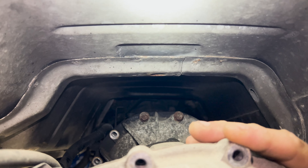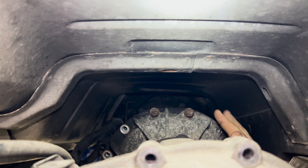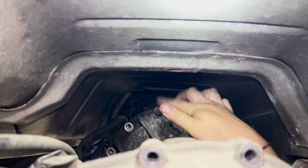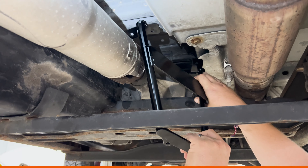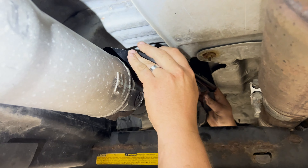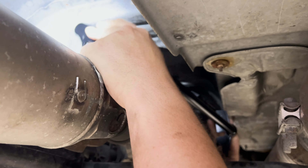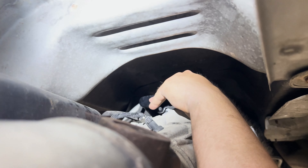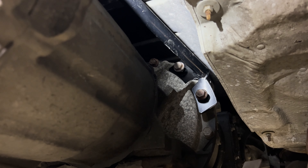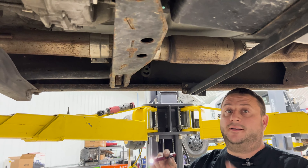You've got four bolts into your Allison and two bolts in your transfer case. To locate those, it's the top two bolts on the transfer case, and then you keep the top two bolts on the Allison adapter housing in there — two to each side. You're going to slide this brace to the top of the transfer case, working yourself around the wiring harness all the way up. Once you've got all six bolts in there, start a few threads, then you can go ahead and tighten her on down.